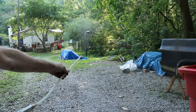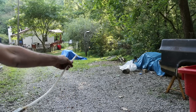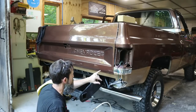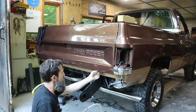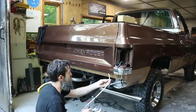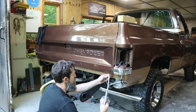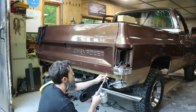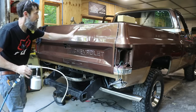Check out that tip — it sprays forward and in four directions, so 360 degrees basically, just a fine mist. These tailgates were really bad about rusting out down along the bottom seam because they get full of leaves and dirt, stay wet, and that pinch seam would start rusting. There are holes down here you can get up into, and I've got the handle out so I can go all the way up in here and coat that as well.